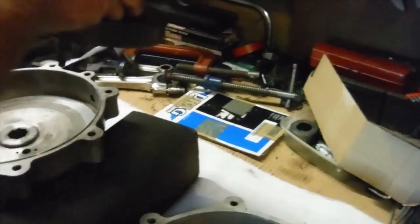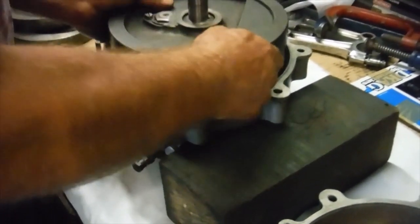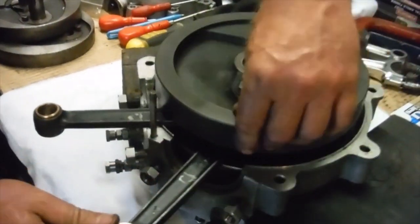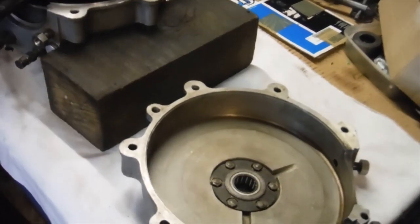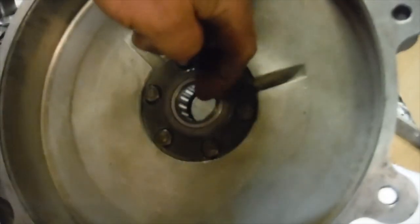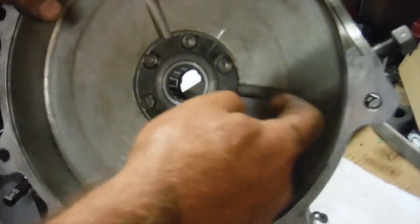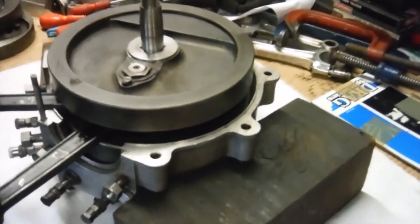So I'm now going to put the crankshaft into the timing side crankcase, so it'll be located by the washer that I've got in there. That will put it where I want it relative to the center line of the crankcase and the conrods. And then next, now when I put this together for keeps, I'll be oiling everything. Put this washer on there, and you can see where the oil will get through those little channels that I've filed from the main bearing. The main bearing is fed by splash through these two channels. There's holes into it. I've got an oil seal in there to stop the oil coming out on the drive side. So oil goes into the main bearing, it's flung about and splashed, caught in the main bearing, oils that, and then from there it comes out through those channels and towards the big ends.